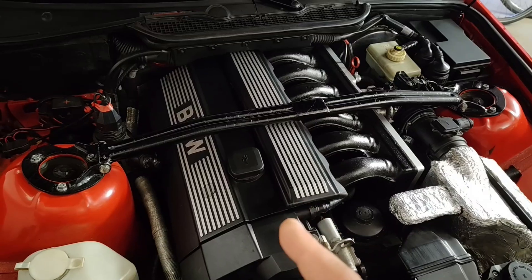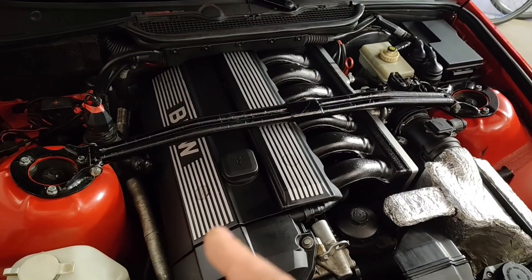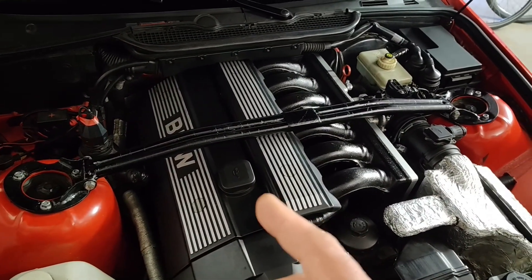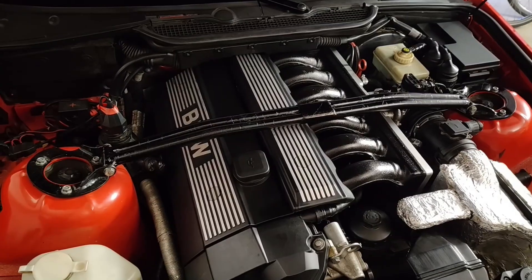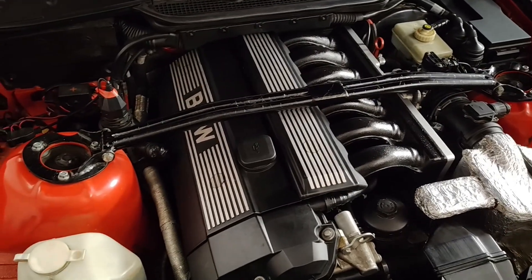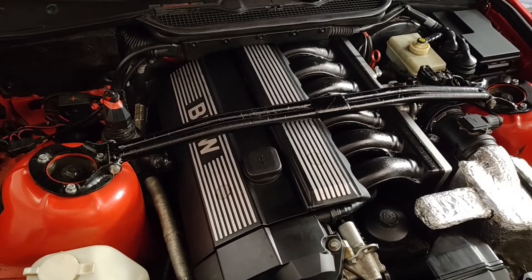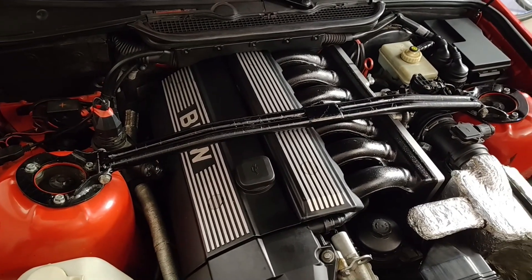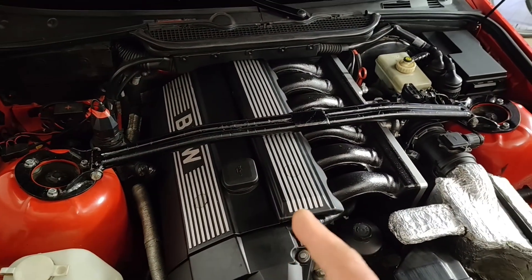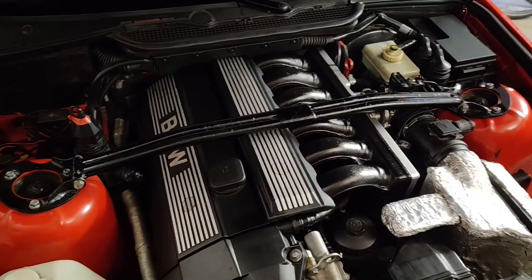The intake valve opens a little bit earlier on the exhaust stroke, so the exhaust can kind of aid — it has a suction effect pulling in the air charge when the intake valve opens earlier. Now this may seem contradictory, because a lot of times you can read online that retarding the intake cam will aid top end but hurt down below. Anyway, I want to put it back to stock now, advance it back, and then see in the logs if that did anything or how it behaves differently.